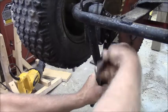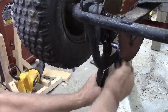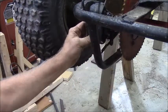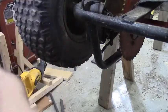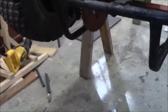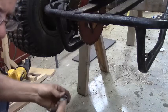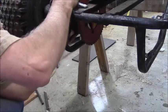I got a good grip with these old Craftsman pliers, which are sort of self-adjusting but non-locking, kind of like vice grips. I got the rod off. To get the caliper out now I have to take it apart to get it over the flange, because this bracket is welded. I have to split the caliper at its separation point with these two big bolts — they appear to be 9-16ths. I started this earlier so I know what size they are.